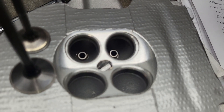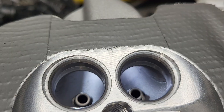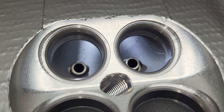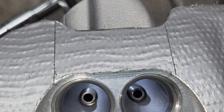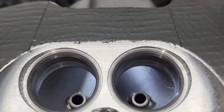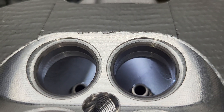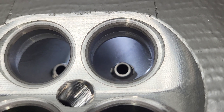I was expecting them to be small, but wow. Let's go over some design features. Obviously, four valve per cylinder has got great breathing. But if you take a look at this — this is our exhaust, see how it turns? So our ports, especially the port on the right, really has a hard turn. And our transition to the exhaust needs work.